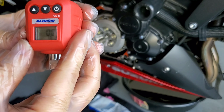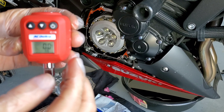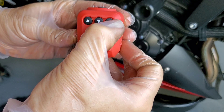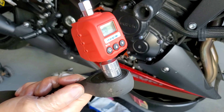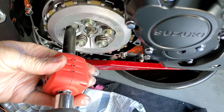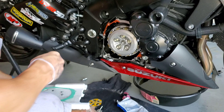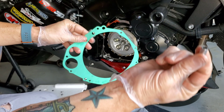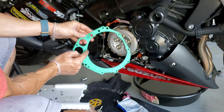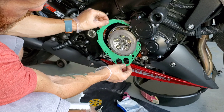Here are the original OEM springs and these are the new heavy-duty ones. The pressure feels about the same, but the new springs are rated 15 percent stronger than the factory ones — so it's just an extra measure. They're fairly cheap, and if you're interested I'll put the part number down in the comments. Now let's get started — I've already cleaned everything up, so I'll go ahead and bring all the friction plates and metal plates back in place.